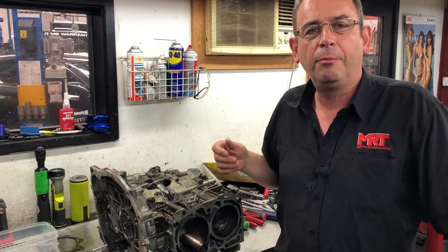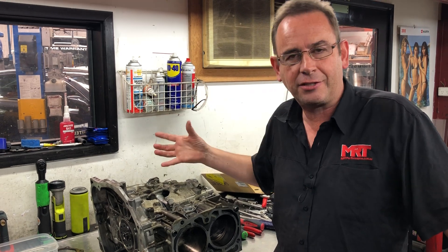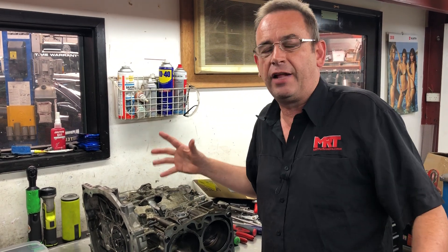Hi, I'm Brent. Today we're going to do a video update to help you understand what you need to be considering if you're doing an engine rebuild. One of those things is it's very common for people to find an engine failure such as this, where you've got a hole in the block. The question is what you need to do to fix it, but more importantly, what actually caused it in the first place. You don't want to go fixing it and then blow another engine because you didn't fix the original cause.